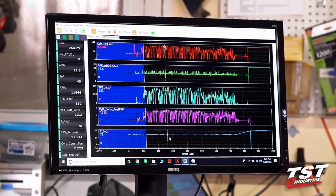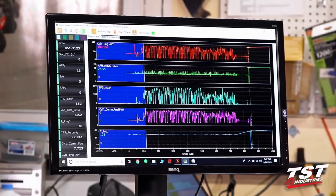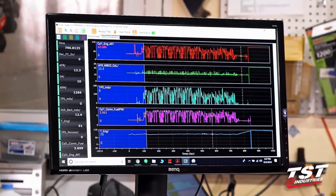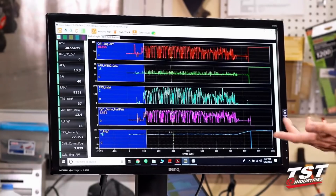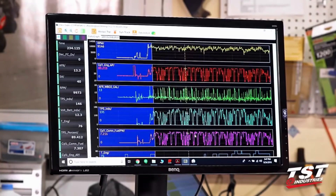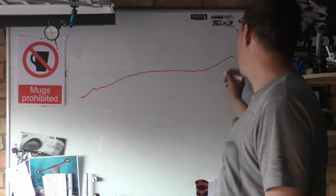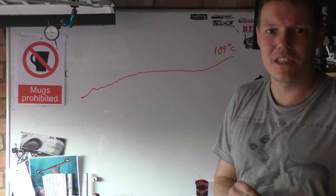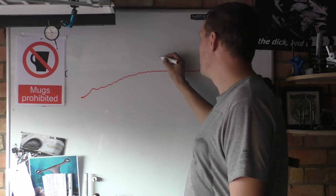After he shut off the motor it went up to 106, then 109 — but that's typical of a heat soak cycle. The motor wasn't running, it wasn't producing any more heat, so that's fine. Everywhere else we look to be at 80°C or below, so that was good. That means we're not going to blow it up due to heat. Thank god it's in Celsius and not Fahrenheit.